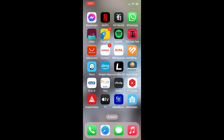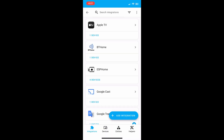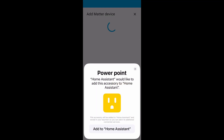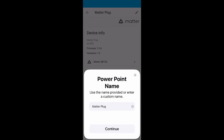Now we go to our mobile phone, click on our Home Assistant app, and go to Settings, Devices and Services, then add a device integration. We select 'Add a Matter device' and it uses the camera. We scan the QR code and you'll see it immediately recognizes that it's a power plug. Now we have to wait — this can take quite a long time; for me it took about a minute or so to load up, but it does work, so you just have to be patient. Here we go — it's accepted the connection and shows that it's got the Matter plug.